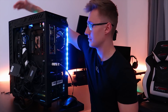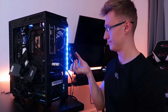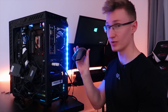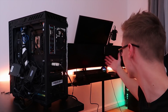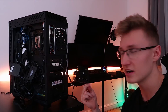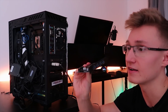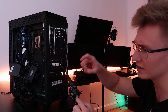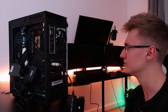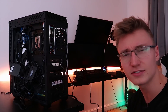I've got myself another Razer mouse. I'm going to plug it into the same USB port and see if we can boot up with this mouse instead. If we can, then the original mouse is probably at fault. Three, two, one — there we go. The PC is booting up with this mouse now. So I've pretty much narrowed down the culprit: the Razer Mamba Hyperflux mouse. To bypass this problem, I've got a four-port PCIe USB expansion card. If I plug the mouse into this instead of my motherboard, everything should be fine. I'm going to plug this back in, power it up, plug the mouse into the expansion card, and see if this fixes the problem.